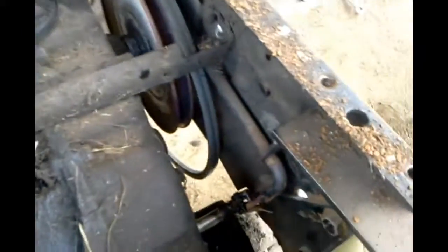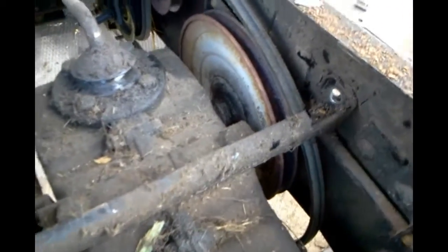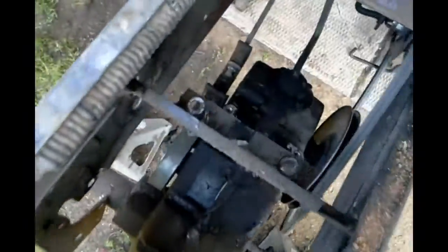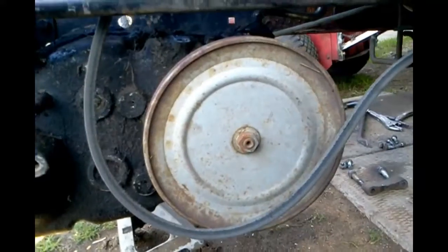Here's the transmission. There's the shifter linkage right here. So this whole piece wouldn't come down, so we got to undo two bolts on there and the whole thing will slide out, then switch the pulley. I got those two bolts out, it dropped down. I had to take out this shifter linkage — all it is is like a chain link. That dropped down and now I can take the pulley off.